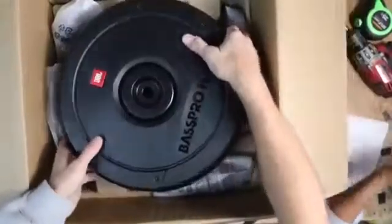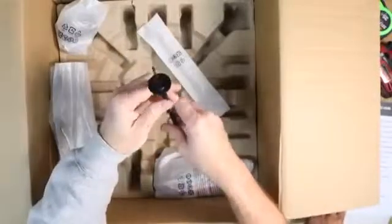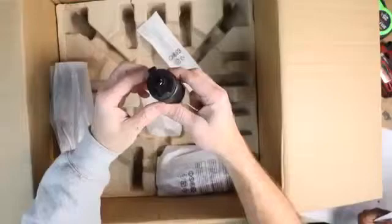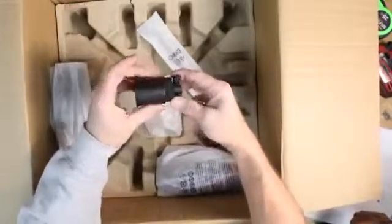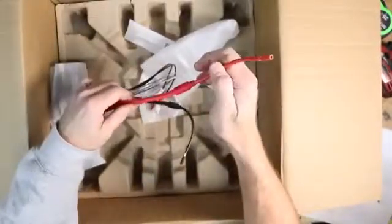Now let's see what else comes in the box. We got a foam package over here. This is going to be the new screw down, so it'll hold into where your spare tire would be. It has a nut style connector if you have the bolt that comes out of the floor. We have the main power harness here. As you can see, what they did is we have 4 16 gauge that go off into a 10 gauge for both the power and the ground.